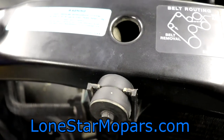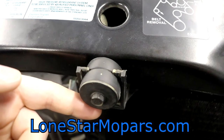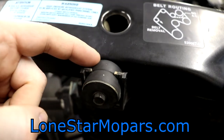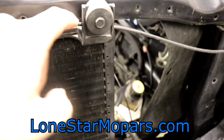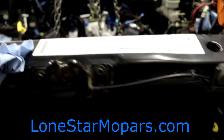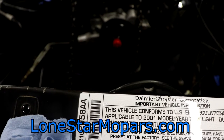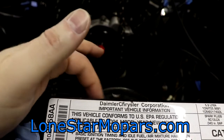There are little dots on the top of both pieces of plastic for the condenser — you can actually see them because they're holding dirt. The bottom front is going to have the manufacturer stamp. If you pull the washer off the bushing, it would just be rubber. The back bushing has a metal-impregnated washer that recesses in — so that's the correct orientation for both. I didn't remember exactly where the hood release cable went, so I just stuck it there for now — it seemed to conceal it and follow a natural routing.